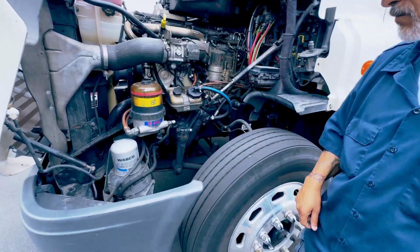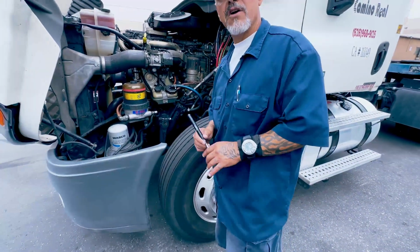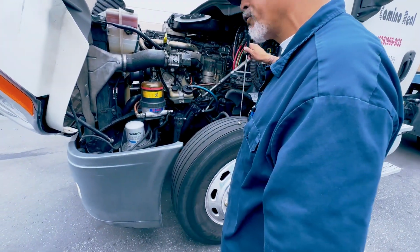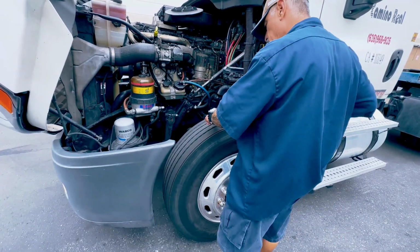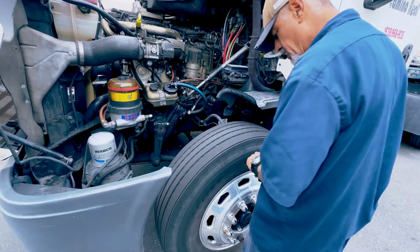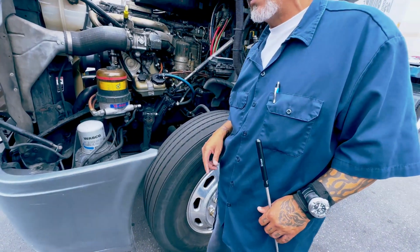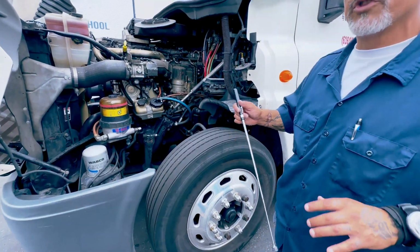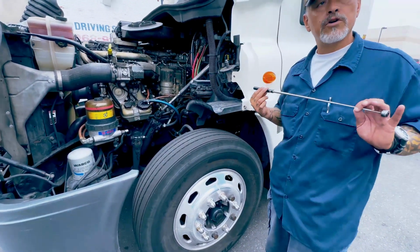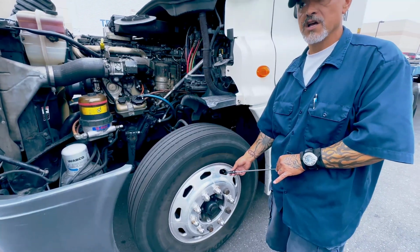Tires. Front tires are not permitted to be recapped. The depth of my tires, I will use the depth gauge. The condition of my tires, no cuts, bubbles, and nails on either side. The inflation of my tires is 90 to 105 or manufacturer recommended. You're going to tell the examiner with your pointer, I will use a commercial air gauge. That's commercial air gauge to check, okay?